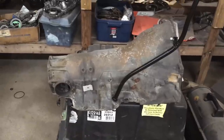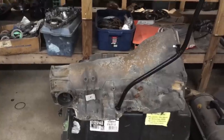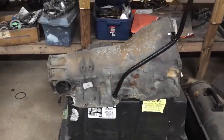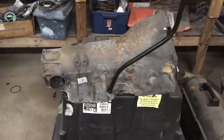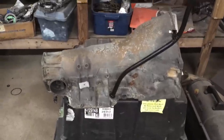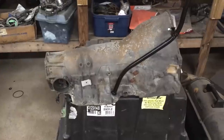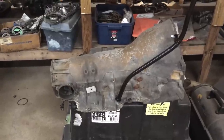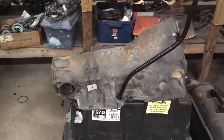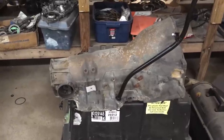That covers proper fluid level and how to adjust for it. There are three most important things for keeping an automatic transmission alive: get the torque converter all the way back — if you don't, you'll break the pump; get the shifter cable adjusted right — that will burn up clutches; and get the fluid level right. If you don't handle all three, you'll end up blaming the builder when really your buddy doesn't know how to check a dipstick.